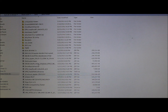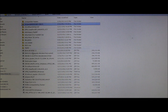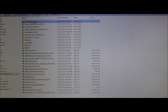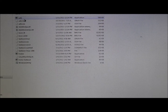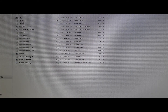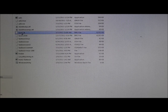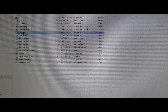The files you're going to need: the Motorola drivers — you should already have them — and ROM Compatibility Flasher by Matt Groff. This is the zip file; you extract it and it looks like this. This is your file structure. This is all the software needed. This right here is the script you're actually going to run, this is the leaked boot image, and this is the stock Jelly Bean boot image. You're flashing whichever one you want.